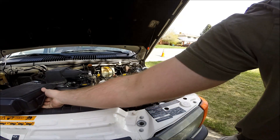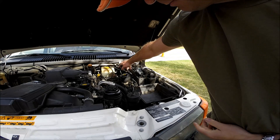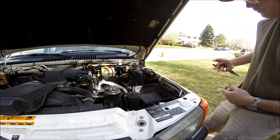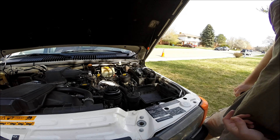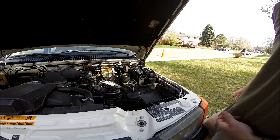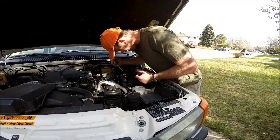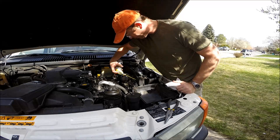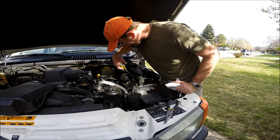It's pretty easy to do. Take a pair of needle-nose pliers — you'll see there's a pipe going into a brass collar. Push the collar in and pull the pipe out. Be ready for air pressure — there could still be some residual in the system. I ran the depressurize sequence in the EAS Unlock version 4 software twice just to make sure. The pipes are stuck in there pretty good, so I'm going to apply a little silicone to act as a penetrating fluid and come back.